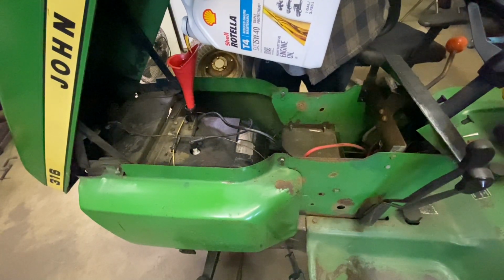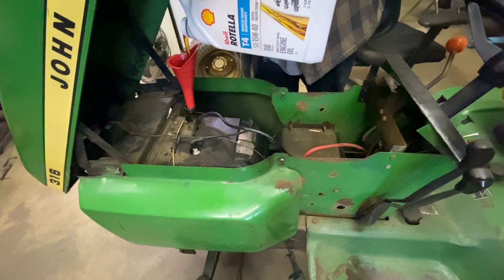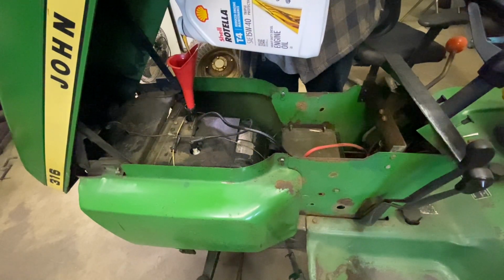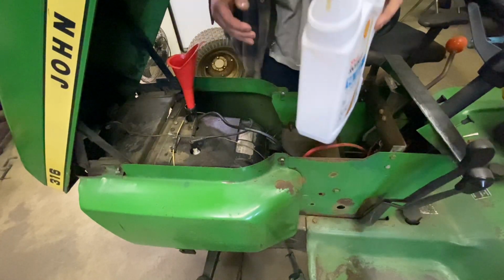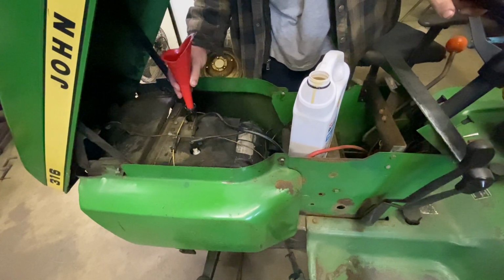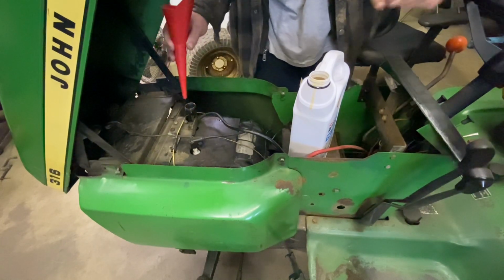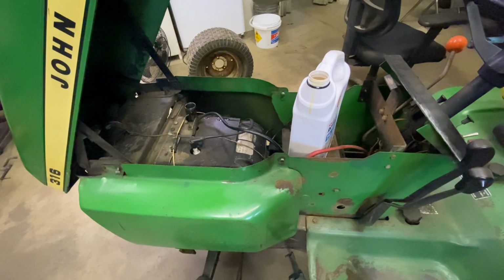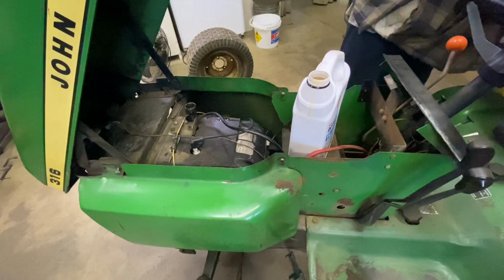And this is a 16 horse. This is the exact same engine as what's in that 216. So I would think if that 216 could survive running 15W40 oil over the summer, we should be able to run it just fine in this guy. So let's let that run down and let's see what we're at. Depending where we're at, I might just put whatever's left in that in there because there's not really a whole lot left in that can,